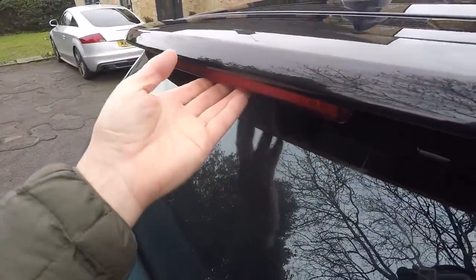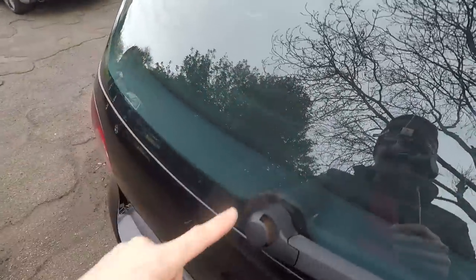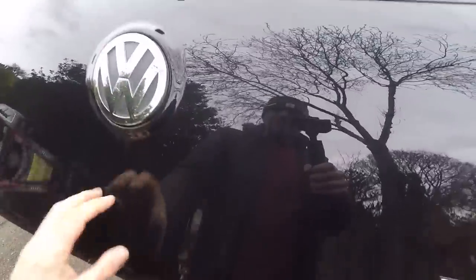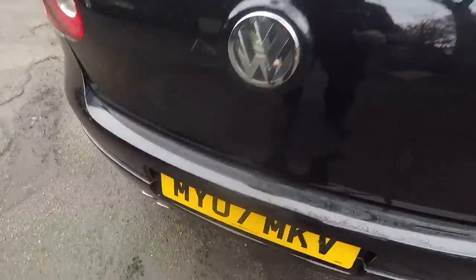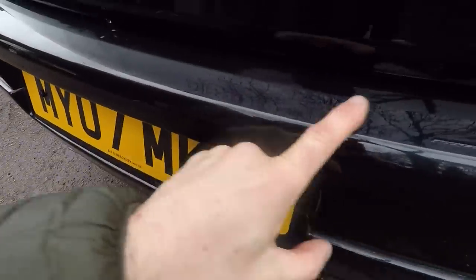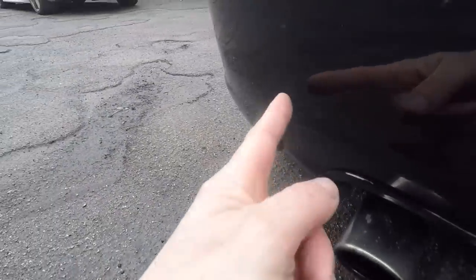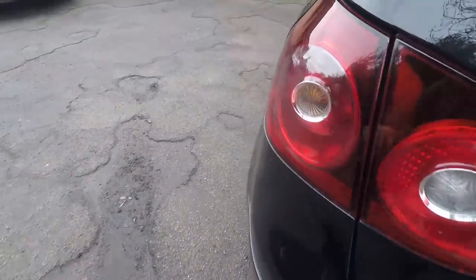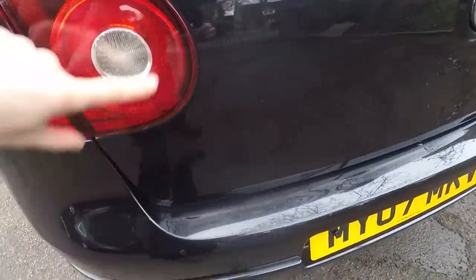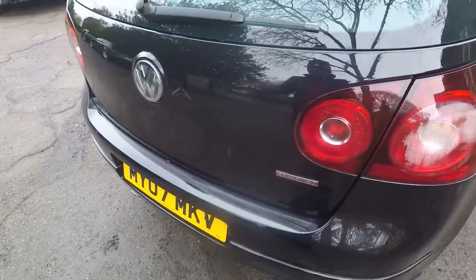At the back, I'd start off by looking at the rear spoiler, because to replace the third brake light you really need to remove this to do a proper job, and some people may not have put it back on properly — but this one looks okay. Have a look at the glass for scratches. There is a bit around there, and then have a good look at the tailgate. Corrosion at the bottom of the badge here is not unusual, but this is actually okay. There's some light scratching here but it should polish out. Top of the rear bumper is very prone to damage, and we do have some — most of this I think we'll polish out. There's the odd chip here that's been touched in. Down here, there's some red paint from something. There's abrasion there that's quite light — that should really polish. If it doesn't, we might need to paint this lower rear section. We've got a bit of a scratch on the lights — there are abrasions all over these, so I think we probably need a new set, ideally, to make it look perfect.